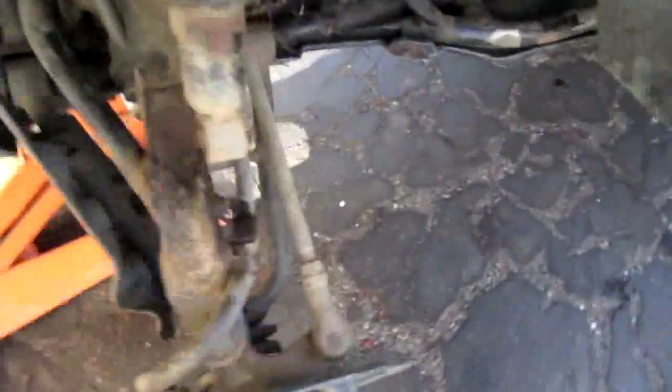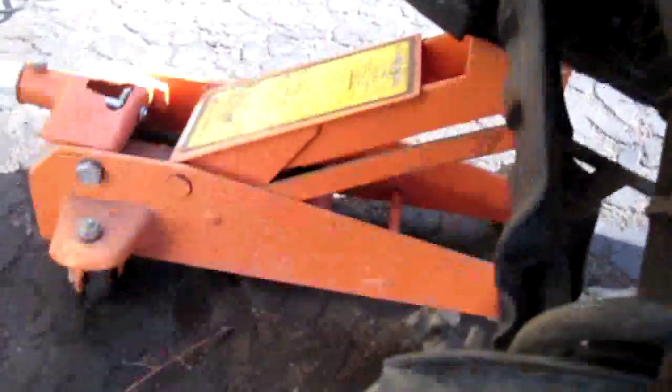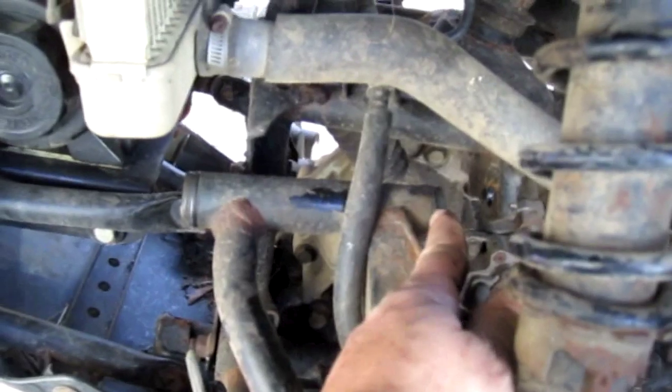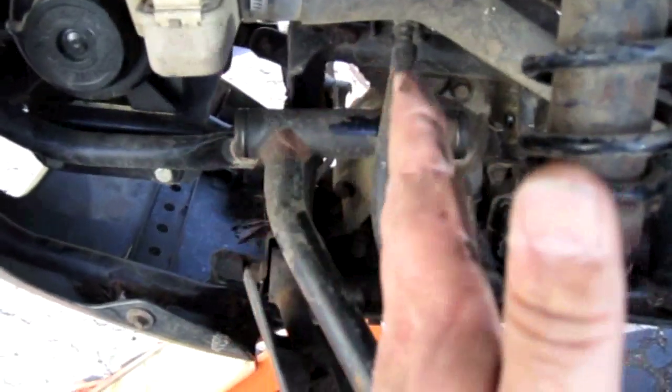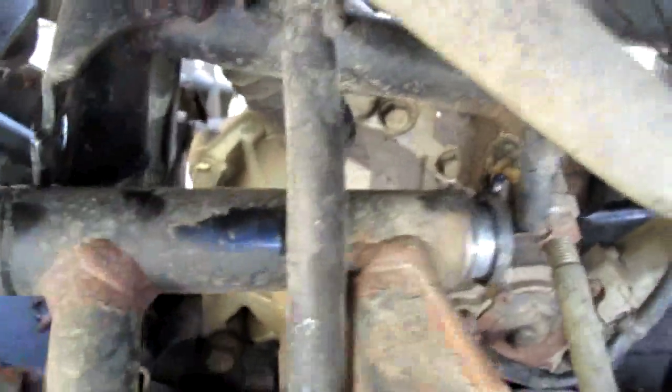This part here is actually the kingpin coming out — that's also going to have to be shortened. We're going to be taking 0.187 inches off the rear end, and then shimming the whole apparatus back by placing a washer up in the front. There's the bushing coming out.